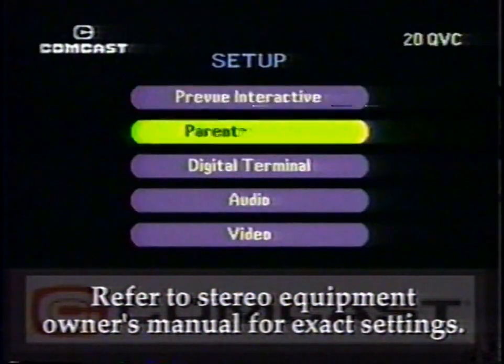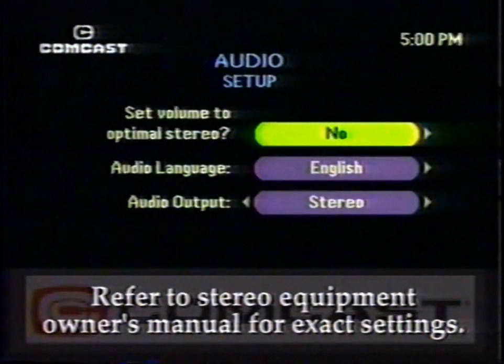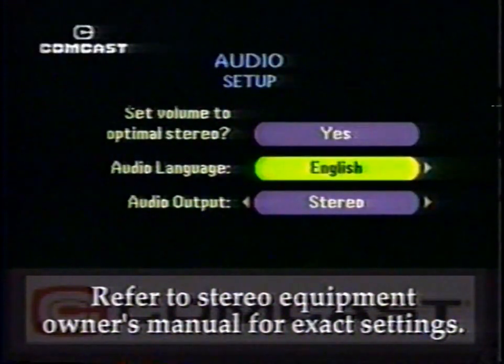You can also set the audio and video to suit your needs. Press the Menu button, choose Setup from the right column, highlight the audio option, and press OK Select. You can optimize the high quality audio signal for your home theater system using these settings. In some markets, you can listen to some programs in Spanish — select Español in the audio setup. Your video setting shouldn't require any changes, but if you need to, you can adjust the position of the screen to fit your TV. On the Setup page, select Video, then move the screen slightly in any direction until it is right for your TV. Take a minute to customize your TV, set up your favorites, and arrange some reminders of upcoming programs. Soon you won't know how you did without it.